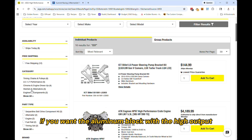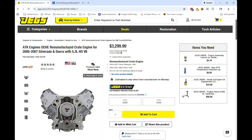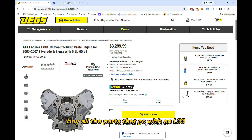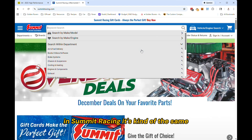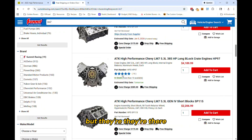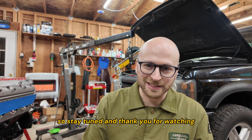If you want the aluminum block with a little more power, you can search for the L33 — it's here on JEGS as well. These make maybe 15 more horsepower. If you get one of these, make sure you buy all the parts that go with an L33, as there may be some differences between the L33 and the LM4 — so when you shop for parts, use the correct reference vehicles. At around $3,300, you can get an L33, which is a fantastic choice. Summit Racing is similar. That concludes this first introduction video. In the next one, we are going to go over all of the additional parts I mentioned that we need to purchase and install them on this LM7. Stay tuned and thank you for watching.